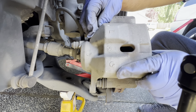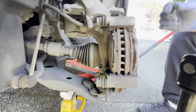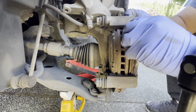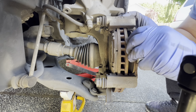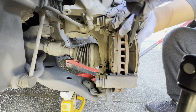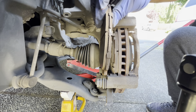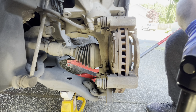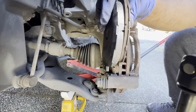For the front brakes I did not disconnect the battery. Here are the brake pads — make sure you take a picture of this so you know how the setup looks in case you need to reference it. Use a screwdriver to kind of pry the pad out. There's the first one — I've got about 30 percent life left.